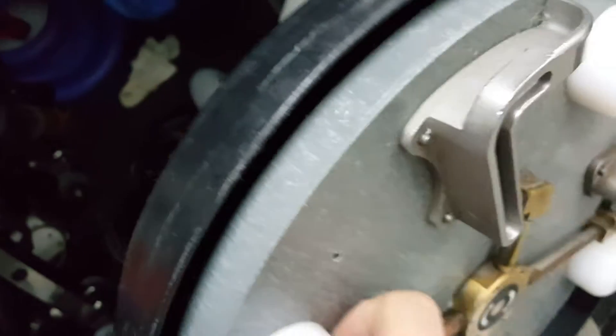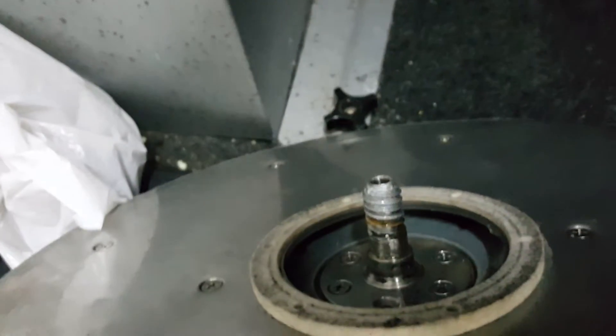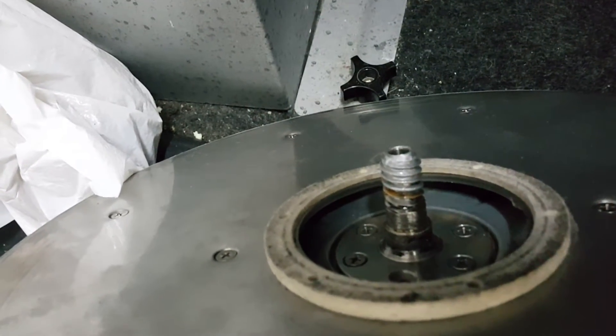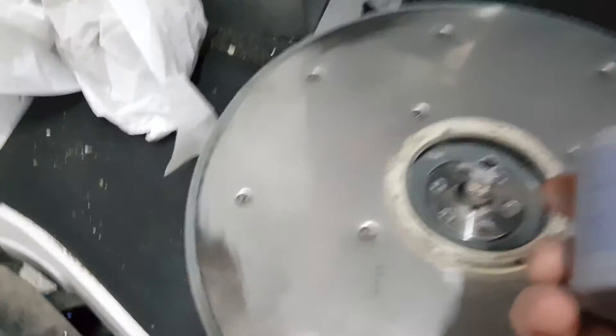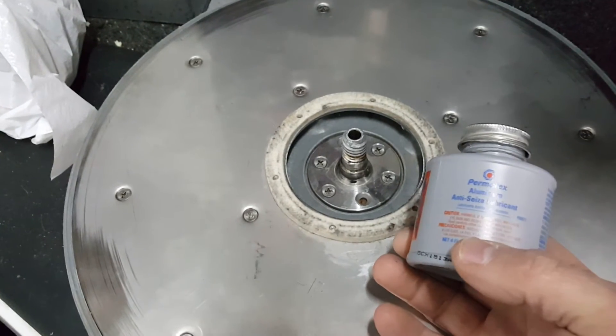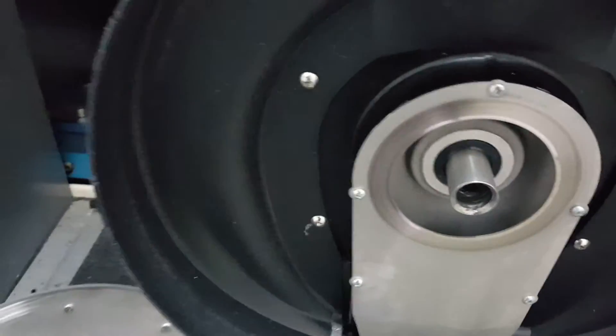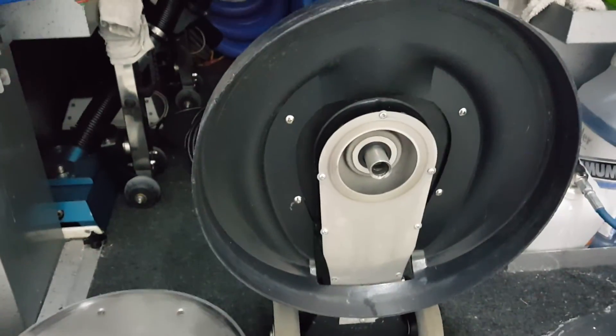Don't hit these if you can — maybe just a kick — but you can end up breaking those. That little screw thread area is what holds on here. You want to take and put some of this stuff on there, at least some grease. This is never-seize, anti-seize, so it'll go on that spot. So again, 5/8 inch wrench on the top, hold it by hand or with a rag, give her a kick if you have to to get it off, and it will work from there.